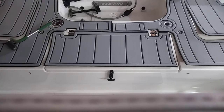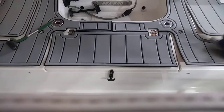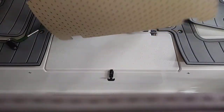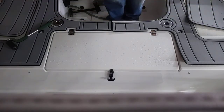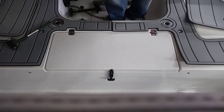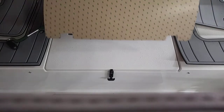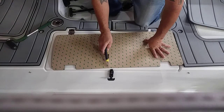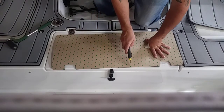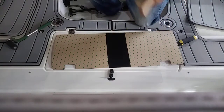Once you're certain that all pieces are laid out correctly, you can begin installation. You're going to need your J-roller and razor knife. The great thing about our material is the 3M backing — many competitors use a self-applying paper backing adhesive that leaks gases, is less effective after sitting on the shelf, and is very hard to work with. Take a sharp razor knife, score the middle of the backing, and take about a 6-inch strip out of the center — bigger for a bigger piece. Peel that piece out and discard it.